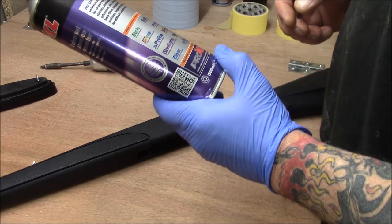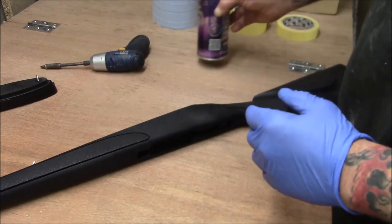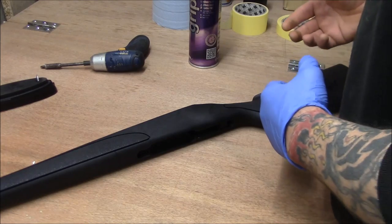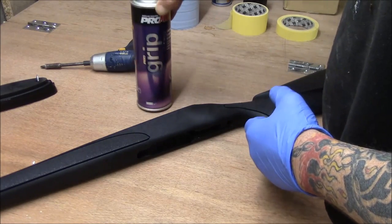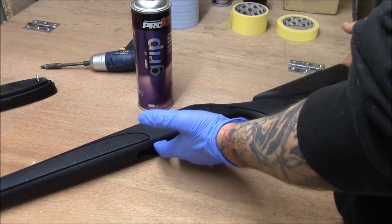painted surfaces. Also replaces abrasion for difficult access areas, so if you're doing a cylinder head and there's a lot of recesses in it, give it a right good clean, very light scotch, get some of the stuff whacked on it, and the Pro Grip should do exactly what it says on the box and grip everything that goes on top and everything that lies beneath.